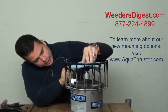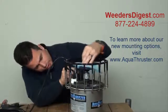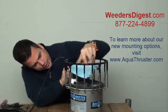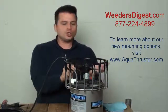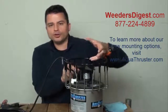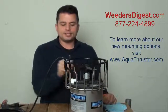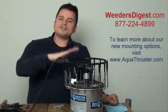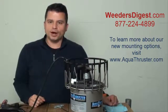It's important to get a good angle, just as I have here while doing this project, so that you can see underneath. Notice we are finger tight — I didn't torque that down, I didn't grab another tool and try to forcefully take that prop to another tightening turn. The reasoning for that is this: the first time you use this product, the rest of the tightening will happen automatically, just as that blade rotates and moves the water.